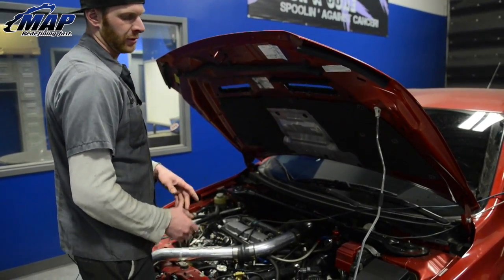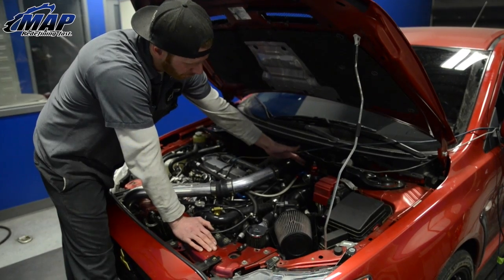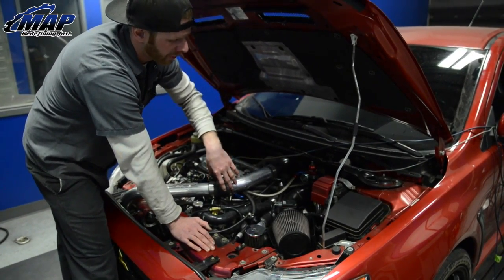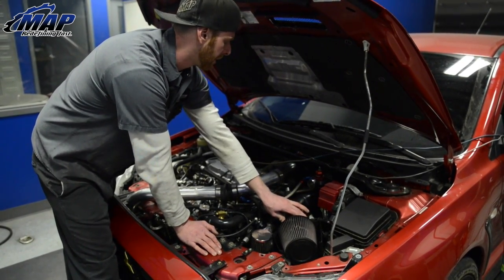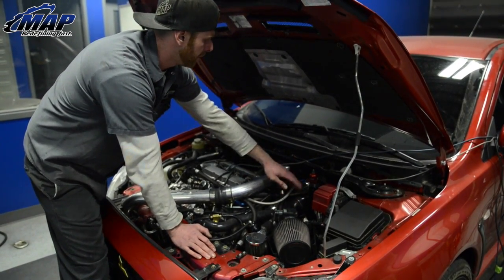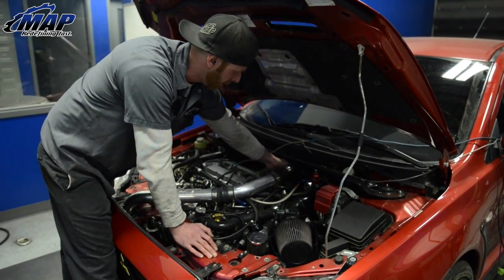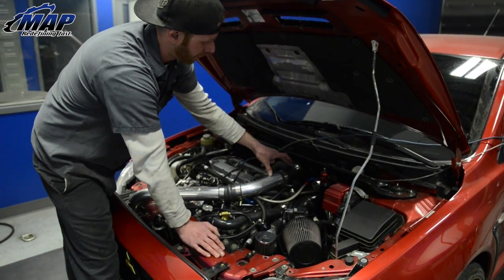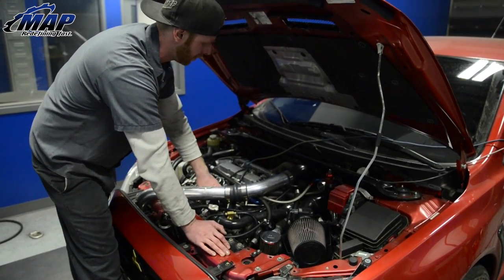Not on all cars can you easily access right to the compressor housing. On Subarus, for instance, you have either the factory soft boot running under the intake manifold or an aftermarket one. On some Evos, you may not have a coupler big enough for the filter. The air intake never sees anything above atmospheric pressure, so if you want to start right after on the charge pipe — say on an Evo, you have your J pipe right off the top of the turbo — you can put your coupler there instead of on the intake and check through the entire intercooler system and intake as well.